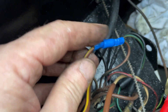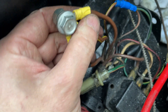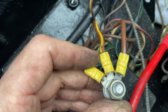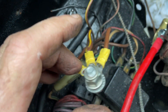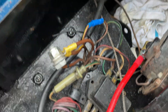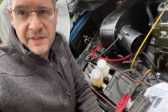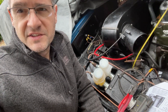So there we have it — the two thin wires connected together. What I've done in the end is connect these together with some eye bolts into the wires, bolted those together, and I'm going to seal all that up so it can't touch any of the bodywork. And that should be my alternator conversion all complete. Once again, thanks for watching, commenting, subscribing, and liking the video. See you on the next one.